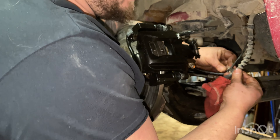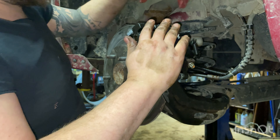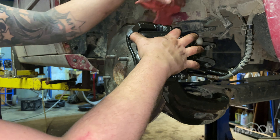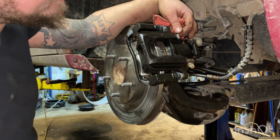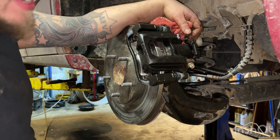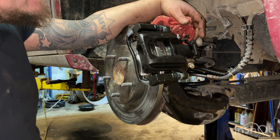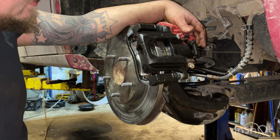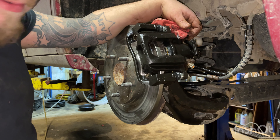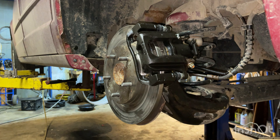Now we can put our wheel speed sensor wiring harness back in its little clips and we are all done except for bleeding the brakes. Start pumping the brake pedal to get the juices flowing, bleed the brakes, and close off the bleeder valves after all the air is out. Pump the pedal a good 5 to 10 times to make sure the piston is seated on the pads. Check that the brakes are working good, throw the tire back on, and take it for a test drive. That's changing the caliper on a Dodge Caravan — thanks for watching, drop a like if this helps!